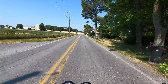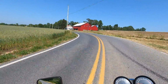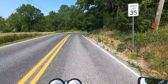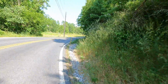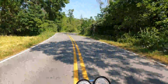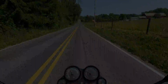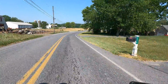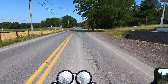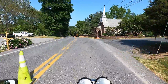And this thing handles so nice. It's fairly tightly controlled. This bike does have the anti-dive front suspension, which is supposed to firm up the damping rates as you apply the brakes. I don't know that it really works all that well. Functionally, it seems to just make the brakes a little bit mushier, and it still seems to dive a little bit under braking, so go figure.